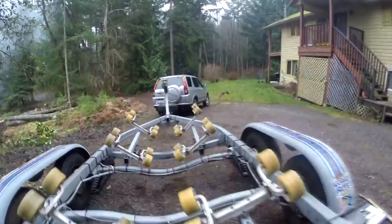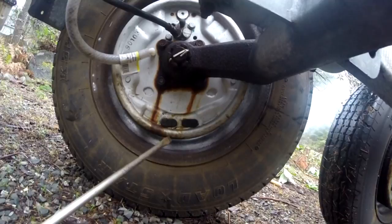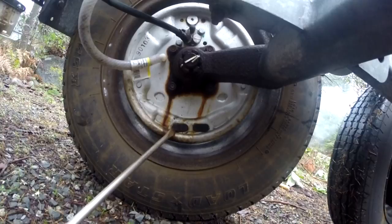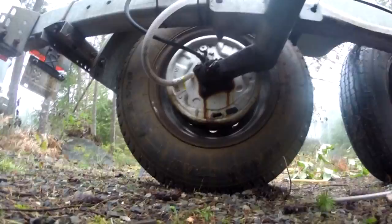So what you want to do is come around to the back side of your trailer, or underneath your trailer, or however you're going to get at the back side. You'll notice looking at the back of the drum, there's two little rubber grommets here. Hopefully these grommets are in yours and they're not missing — if they are, it should still be the same. So using two hands, you can just pry off this rubber grommet here. Put it aside and grab your little flashlight.